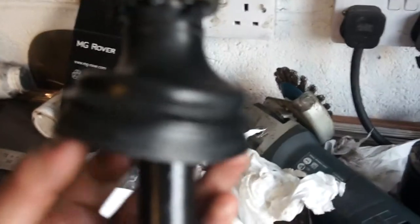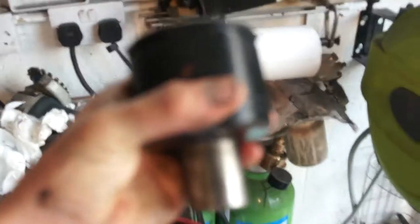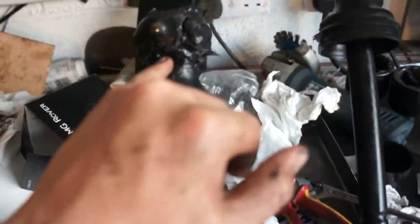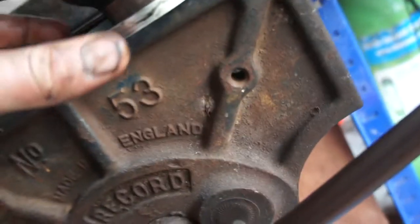I'll get new clips instead. Remember they go on the inside, then you fold the boot back over and the pod joint sits on top. That's where I'm stopping for now because I need more clips for both shafts. Also I need another boot clip because this one slipped off - it wasn't put on correctly.